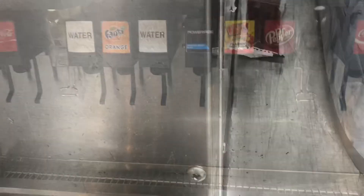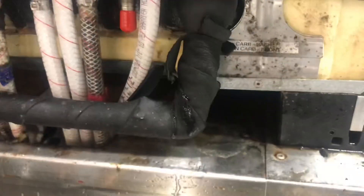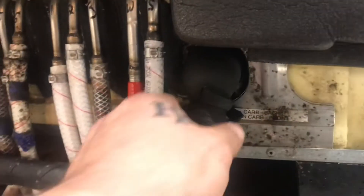Your machine will start leaking underneath. First, there are two screws on the front panel — take those out and slide the front panel out of your way. I'm going to confirm it is the ice portion leaking. Take this off and you'll see the water will pour out. It's clogged up.